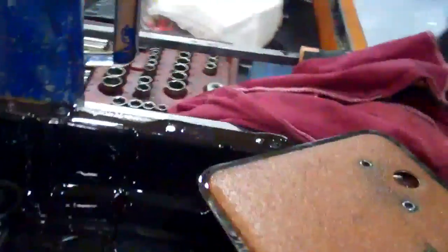We're replacing the filter, and you mentioned that in reverse you had some slippage. You can see these are metal flakes right here on the bottom of your pan. Your pan is black, so that's normal, but you can see something's wearing out in there. You can also see down in the bottom here where the fluid is, there's some sludge buildup in there.